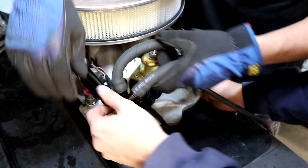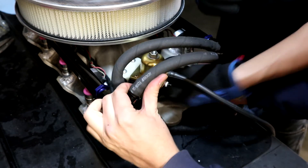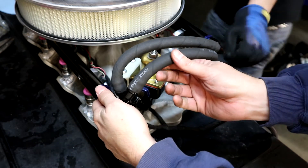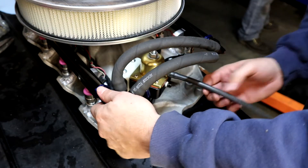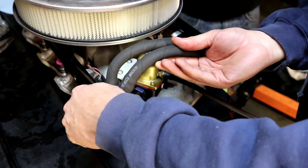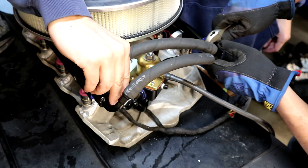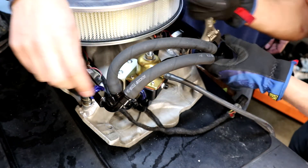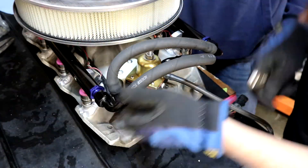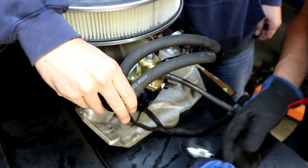In this case we're using a crescent wrench because we don't have the right AN wrenches, but it works just the same. You can also put a little tissue between the jaws of the crescent wrench in case you don't want to scuff up the fittings. Lyle's holding the hose in position and retightening all the fittings so they'll be sitting where we want them without having to use zip ties, which looks kind of hokey.